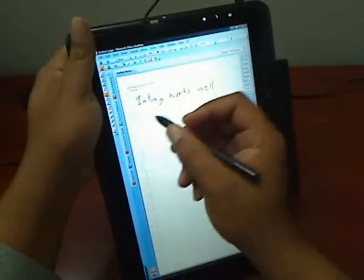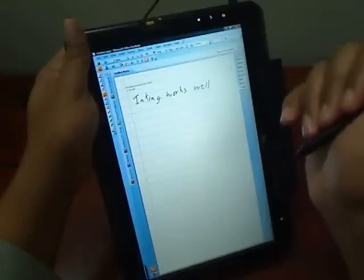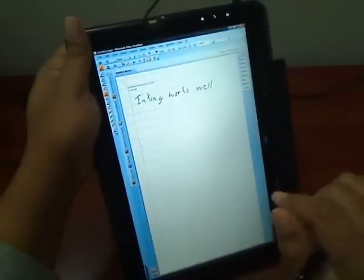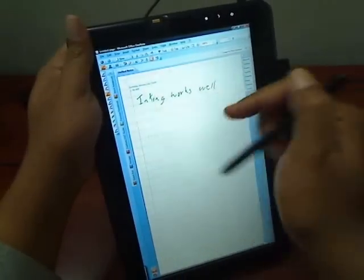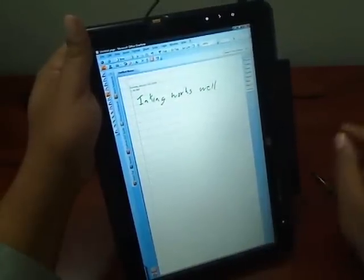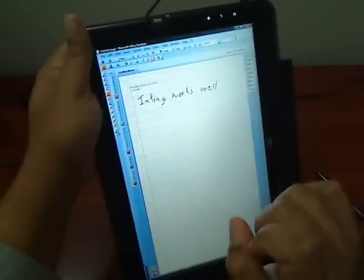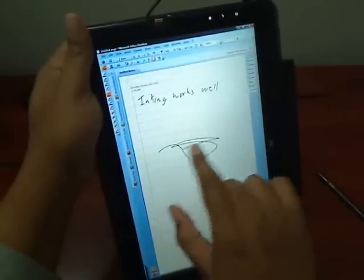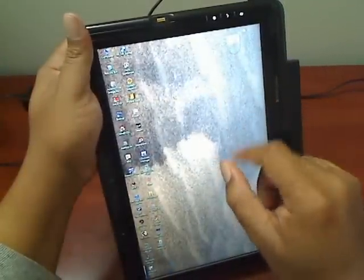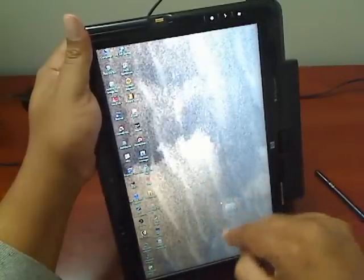As you'll notice, while I was writing — this being a dual-mode digitizer — touching the screen hasn't caused input to the unit. The Ntrig digitizer has several modes of operation; the one I like the most is what they call auto mode. In auto mode, the pen takes precedence over the touch interface. So as long as the pen is in proximity to the screen, there's no touch response. I'll put the pen down and quickly double-tap the screen — you can see that little blinking blue square just popped up. That means now the unit will respond to touch. I can touch the screen and get touch input.